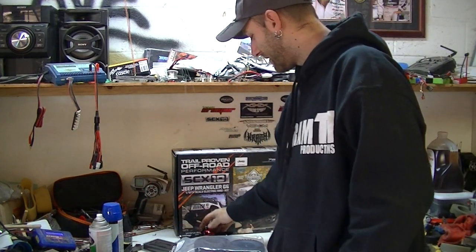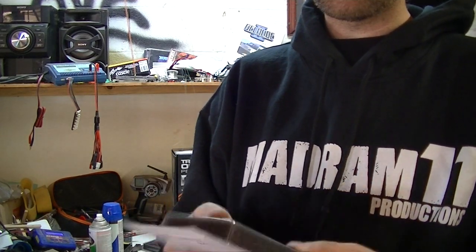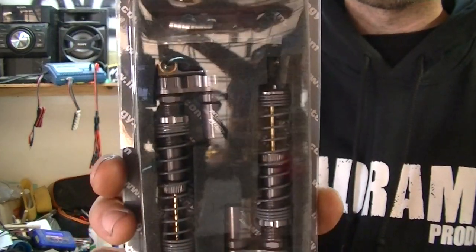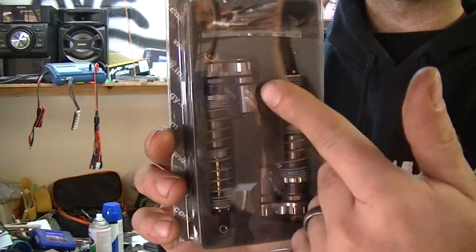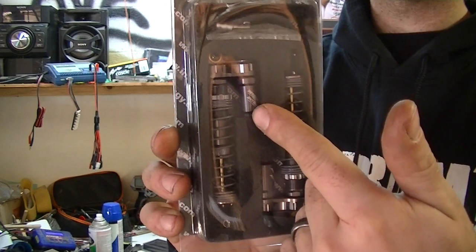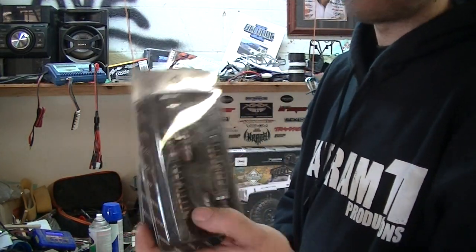So we've got a set of bulletproof axles. And shock-wise, since I'm going to be running a little bit larger tires, I decided to go with the T3 105mm piggybacks with functioning reservoirs — just like the Kings. When that shock compresses, the fluid externally bypasses the shock and goes into the reservoir. It will come up out of the shock into the reservoir, and then when it decompresses or you get your rebound, the fluid will come back through the reservoir into the shock to fill it back up. So a pair of those to go all the way around.